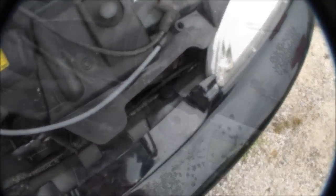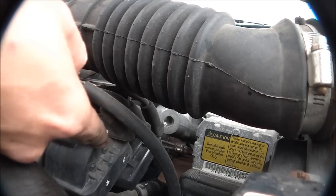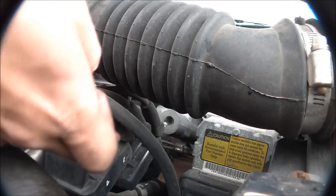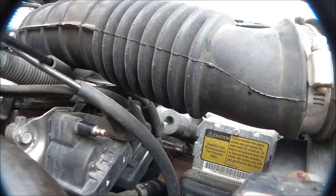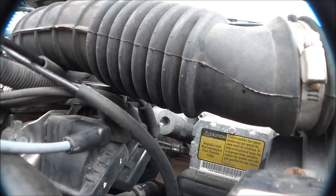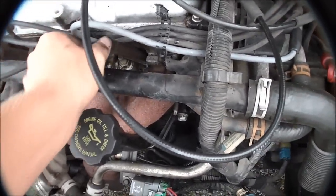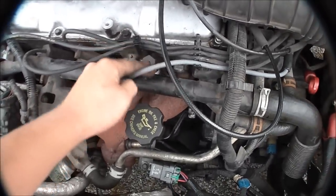The shortest wire is going back in. I'm going to put a little bit of dielectric grease on there because it's kind of corroded — keep it from doing that. Put a little bit on the plug like that. Snap — put that on, that was really easy actually. Bring it on through here, put it back in the loom, and then put it back on the coil plug, just like so.